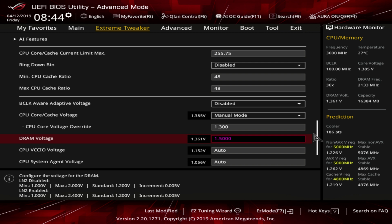It is worth noting that lots of DDR4 memory chips are actually temperature sensitive in the sense that they lose stability if they get too hot. That is different from degrading, okay? DDR4 is rated to survive all the way up to like 85 degrees Celsius, and that's the lowest temperature rating you can buy. There's industrial grade DDR4 where it's up to 95. So in terms of endurance, you don't have to worry about it. The issue is a lot of memory ICs, if they get like 5 degrees hotter, it totally changes the memory timings you can or can't run.